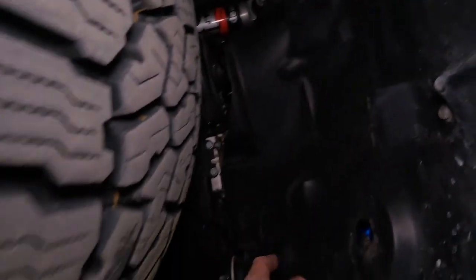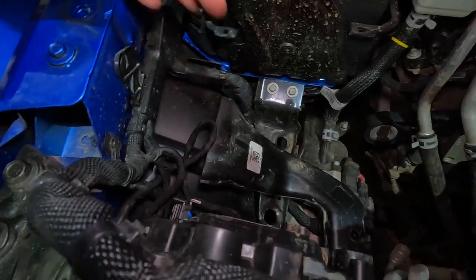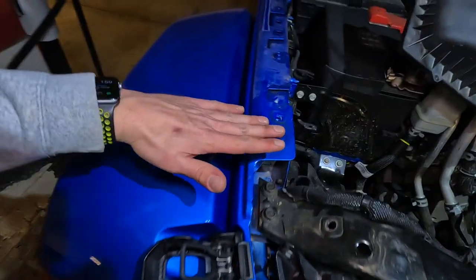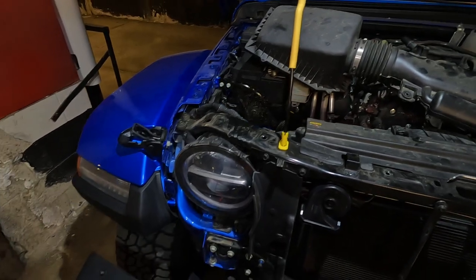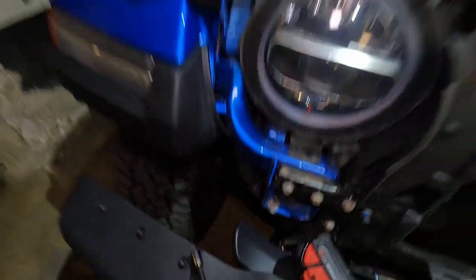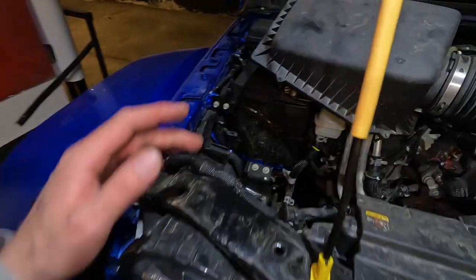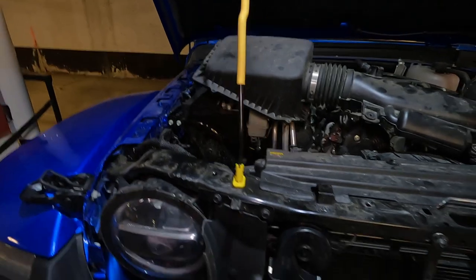The thing is, with this stock system, if water comes in through your fender — like if you get any water in behind your fender liner — it starts to get into this area where your intake is. Even though it's a little bit higher up, there's a gasket on the top but no gasket on the bottom. So this does draw air directly from in there, as you can see by the dirt. If any water splashes up or gets in behind your fender liner, bad time. That's basically why I'm doing this — not because I want to do any crazy submerging, but just as insurance.